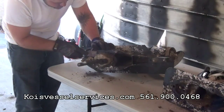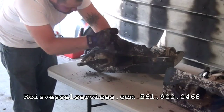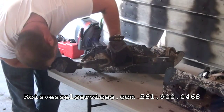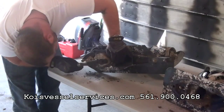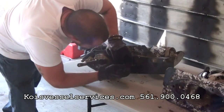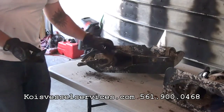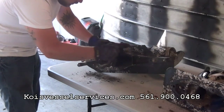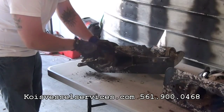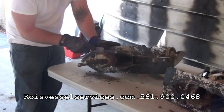And inspect the impeller as well and make sure the impeller's looking good. Some pretty nasty stuff — the boat has been sitting in the water for years. This outdrive also had one of the tabs right here on this fin broken, so I'm going to have to get this welded back together. Save some money rather than spend an extra $500 or $1,000 to get another lower unit housing. Just going to try to save money everywhere we can, considering boats are expensive enough.